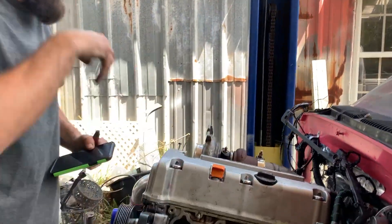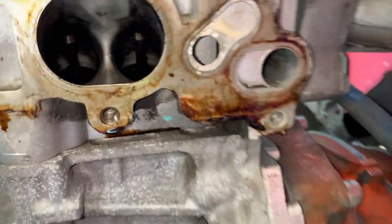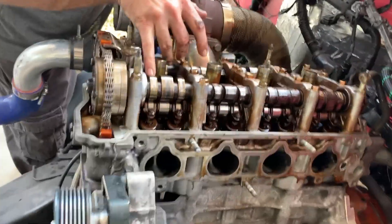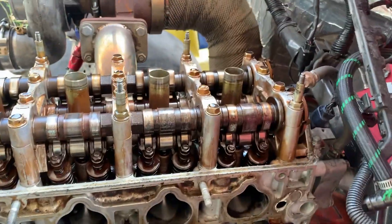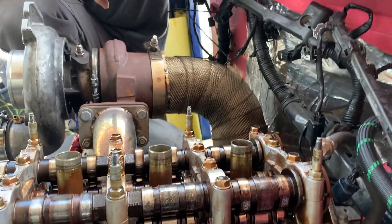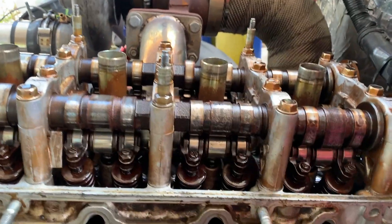Should we pull the valve cover and turn it? Why not just change the motor - the valve looks like it's further down than an open valve, the very back valve. It's hard to tell, let me grab my big light. Look at that - all the hardened surface is missing on most all of them. I know this motor ran when we put it in and I'm not knocking anyone, but it had a long life. It had surface rust on the cylinder when you fired it up - it wiped out the rings. That's why you're dumping oil.